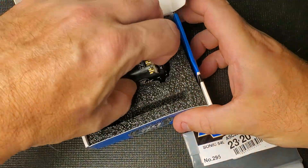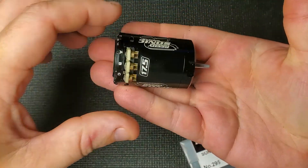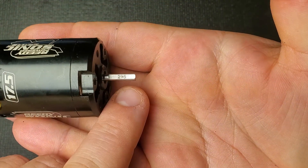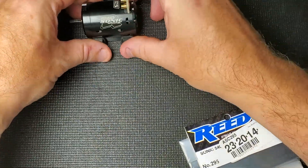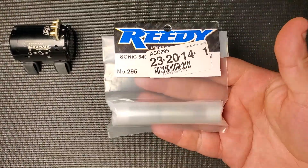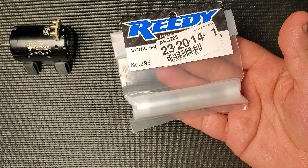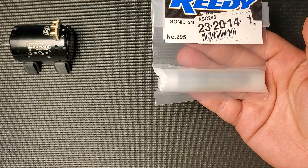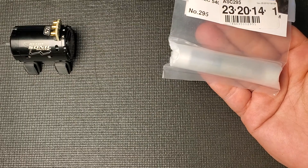Now with this fixed timing series of motors, the spec rotor in it is a 295 — you can see that written on here. They claim these are replaceable and rebuildable, and they sell these separately. The reason I bought a few of these is I found at the end of a race season my motor was getting a little bit off — the edge was off, it wasn't pulling as hard. So instead of getting a new motor, I figured I'd see if replacing the rotor in it would help.